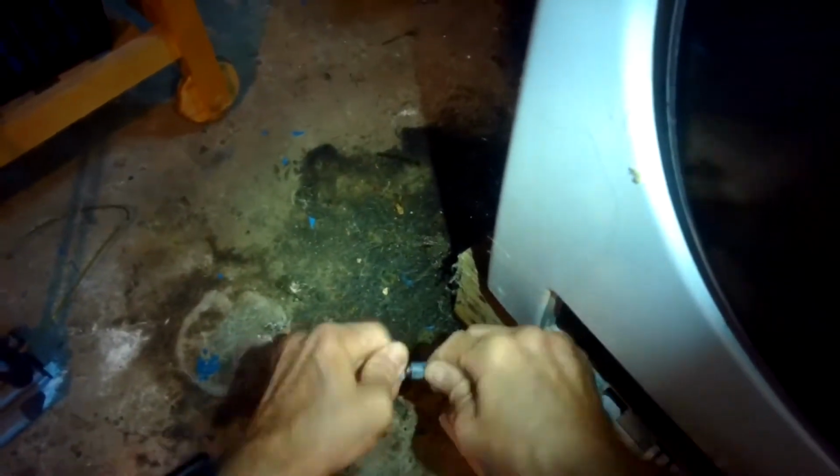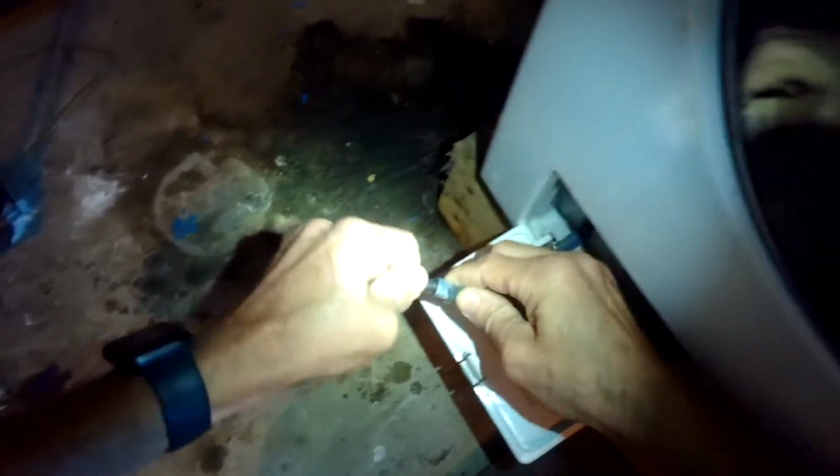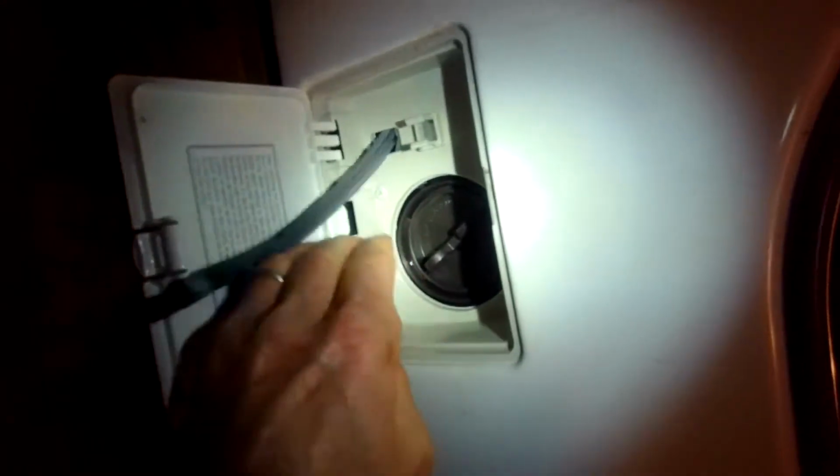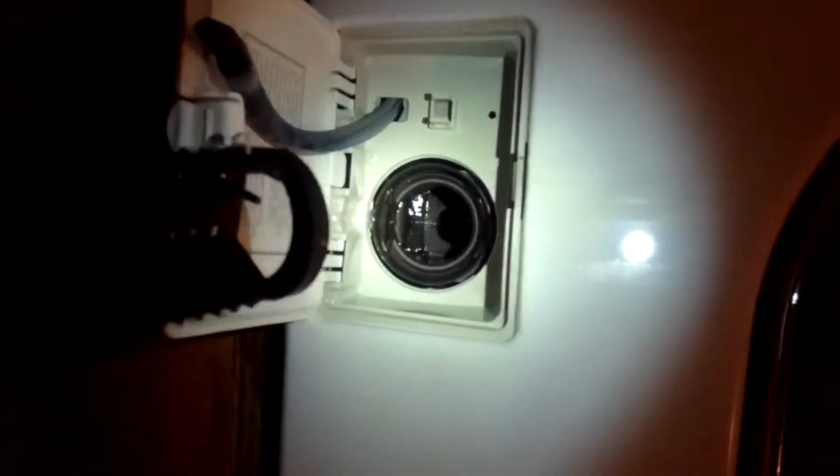And before you do that, it's good to try to drain out any water that might be in there. So you can open up this little guy, and then that water will just come out. I think this one's already done. All right. And then you can remove the coin trap. Maybe a little more water will come out. Make sure there's nothing in there. More water came out. So you just look in that hole and make sure nothing's caught in there. Looks pretty good. You probably just see the rubber, but sometimes you find an article of clothing in there.